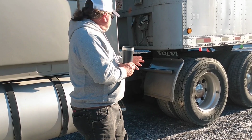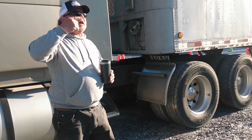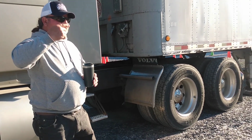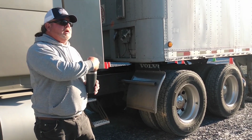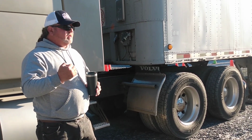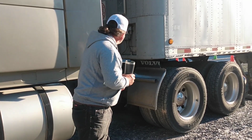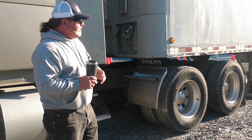If the lines don't have anything on them, your tractor protection valve, if it's up and down, the one on top should be the emergency. If it's horizontal, the one closest to the outside should be the emergency. Okay? Everybody with me on that? All right, so somebody grab these things.